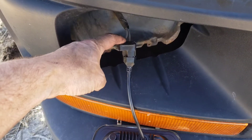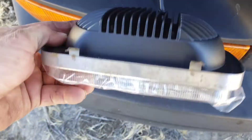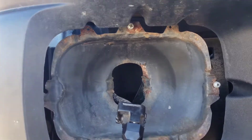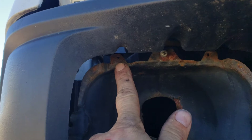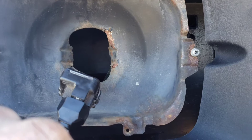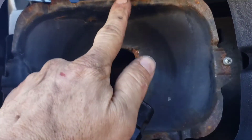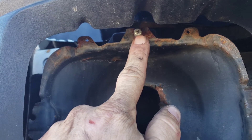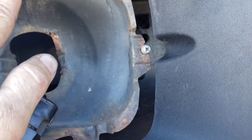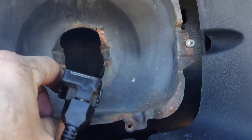There's your original plug-in and there's the plug-in for this LED light. I've put that metal ring on and now we're just going to feed that back into the headlight hole. You've got four screws. On these older style headlights, this adjuster here — you unscrew it to aim the headlight down, screw it in to aim it up, and this one controls left and right spread.